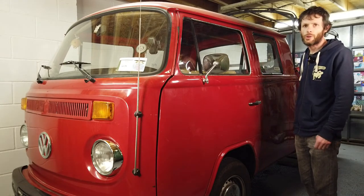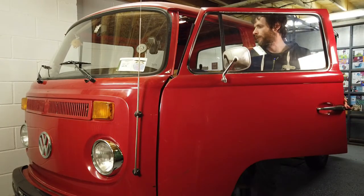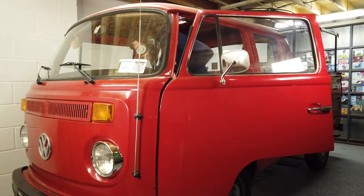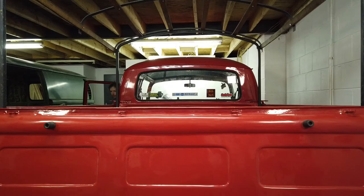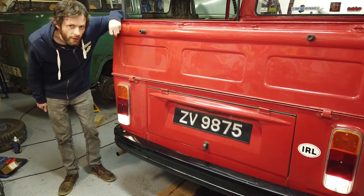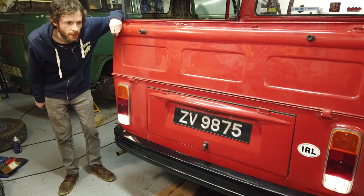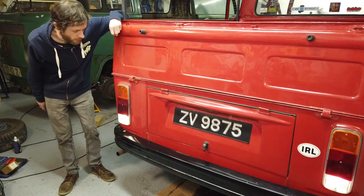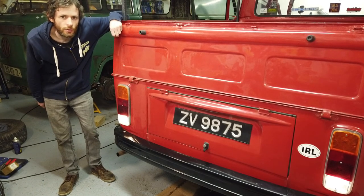I've put the second washer on the switch and refitted it to the gearbox, so I'm just going to get in and test if we can go into reverse now. It's going into reverse — let's check if the lights are working. They're working! So that was a nice little upgrade to do to the van. A bit of extra safety at night when you're reversing so that other people behind you can see you. Really happy with getting that working — thanks for watching and I'll see you in another video.